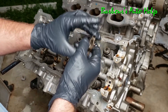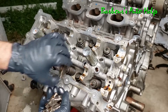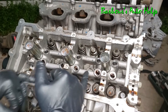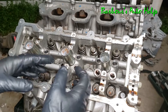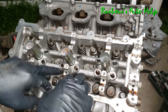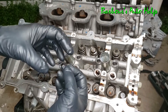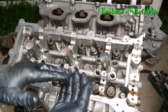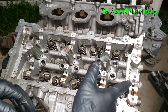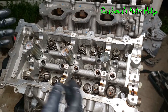Each one of these valves has its own cam follower or rocker arm and tappet. You've probably noticed these little recesses here that the hydraulic valve lash adjusters sit into — those recesses are linked to these little channels right here, which are bored out on the inside. That's where high pressure oil goes through and feeds each one of those tappets. The tappets in turn get filled with that pressurized oil to take up any slack between them and the cam followers. That oil gallery also goes up to where the front of the cams connect to the head, and your cam caps are lubricated by holes running off those oil galleries as well.